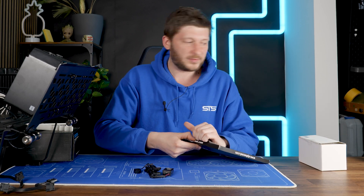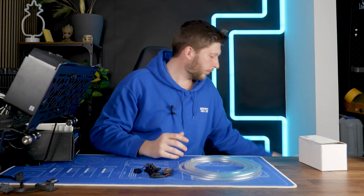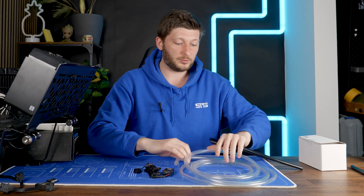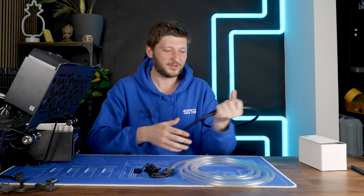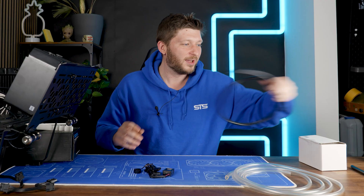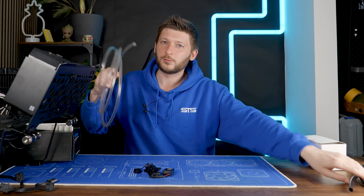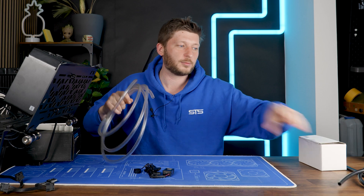First up, instead of buying more of those black tubes, I decided to buy a transparent one — one long three-meter transparent one — because I realized during the buying process that it makes so much more sense to see where liquid is going through, so I know when the whole thing is filled. It doesn't need to be pretty, it just needs to function. Three meters is probably not enough for everything, but for everything between the water block and reservoir and water block and pump we can use the black ones — that doesn't really matter that much.